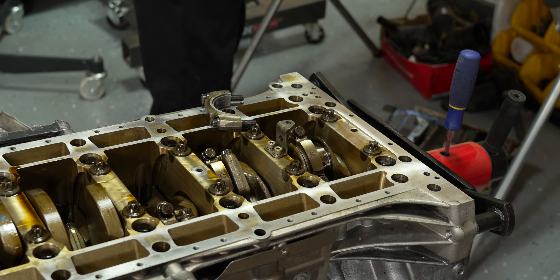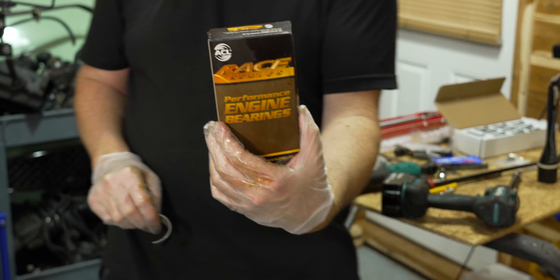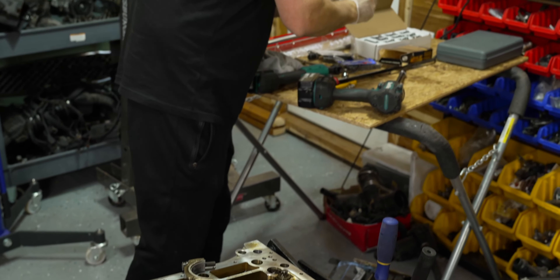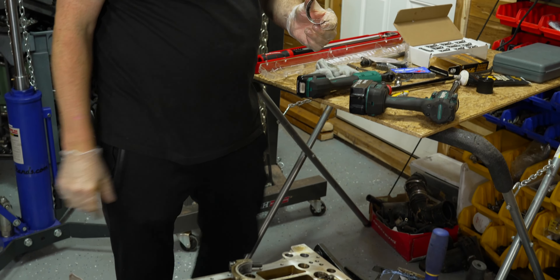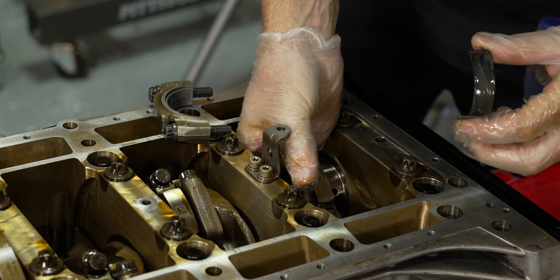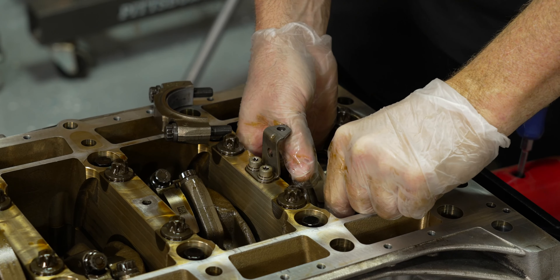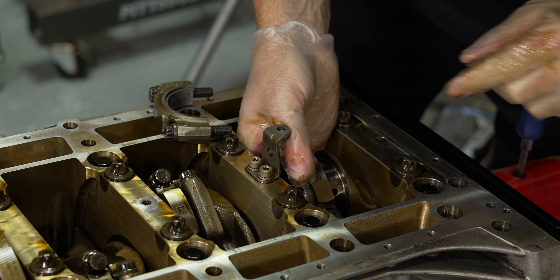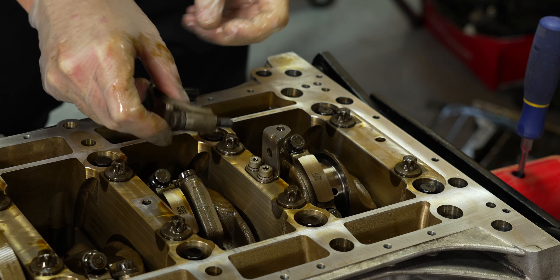Let's go ahead and reinstall a new bearing. We're putting our ACL extra clearance race bearings in. Sorry, I'm just holding stuff at random while Phil's trying to follow me with the camera. We'll go ahead and get a little pre-lube on it - give her a little smear around - and we'll push this up. Line your notch up, goes in here like this. Line the bearing up, it is all the way down in there.